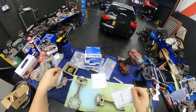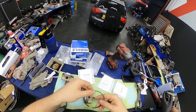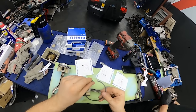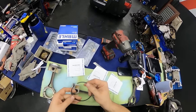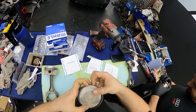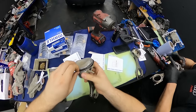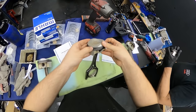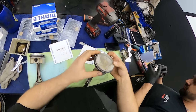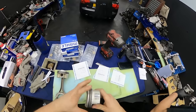Then B, which is the middle one, has some dirt from the factory, because Italians know how to do pizza and pasta, but rings are like, you know, not a finished product. So gotta be careful. On the middle ring it says top, so that means that should be the top. Okay, so we'll put the middle one on there. Again, careful. Okay, again make sure it's moving freely.